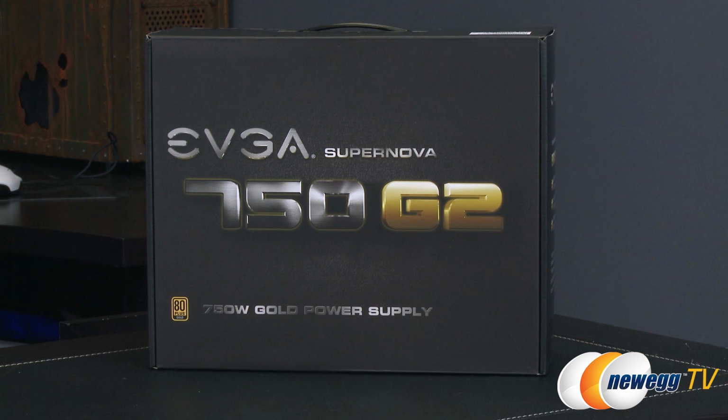And just a quick and very brief explanation of that. It's basically its efficiency rating and breaks down for gold as having at a 20% load on the PSU, you're looking at 87% efficiency. At 50% load, it's looking at 90%, and 100% load, it's 87%. So you're basically losing anywhere between 10 to 13% to heat.